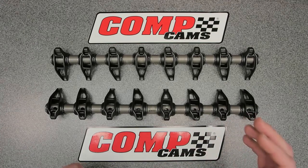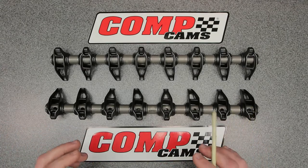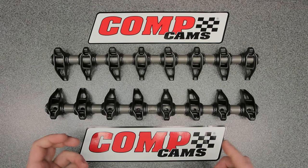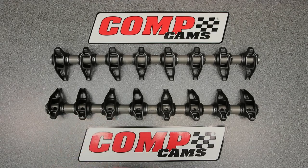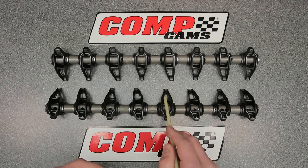Those add height to the actual valve train and in most situations like the LS9 you cannot add a taller valve cover. It's really frustrating finding upgraded rockers for this LS9 build. I have a stage 4 cam with more lift - 629/600 - and I want something more stable at higher RPM. Anything past about 5,000 RPM and up, the stock rocker is very unstable, and the LS3, LS9, and LS7 style rockers have an offset intake, meaning side loading, which causes accelerated wear.